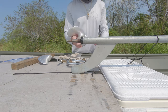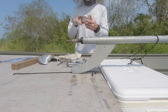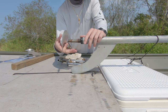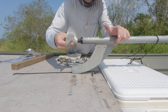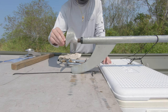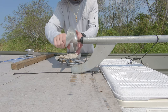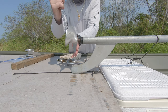Take off this prop — this is the weedless prop. This is almost all I use. I'll use the nine inch if I'm going a long ways. Props are only one way to go — you can't put them on backwards because they just don't fit that way. You do have the keyway. No difference in prop nuts if it's short or long. The long ones are just meant to fit inside the prop for racing and performance props.